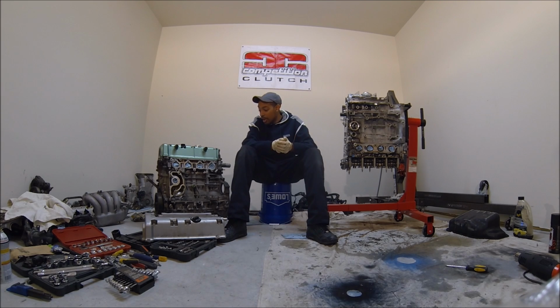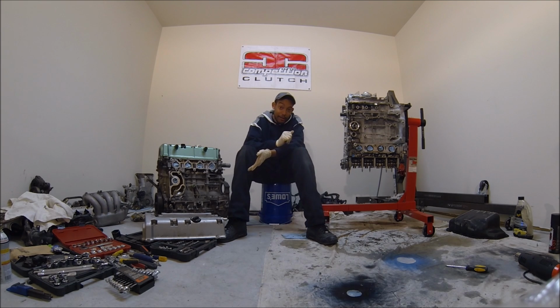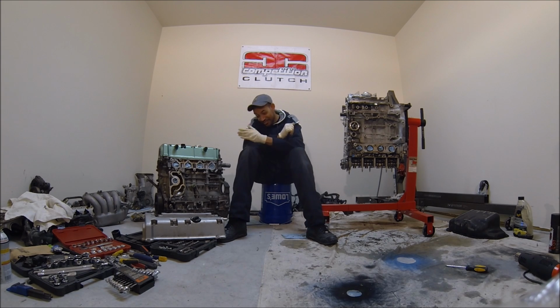And well, once again, it goes back to the parts you're running. This right here with some quality bolt-ons will hold its ground against even one of these that's got a piston and cam setup, and that's just with bolt-ons on it. You get some good bolt-ons on your K20 over here. I would not recommend down swapping to a base motor if you already have this.